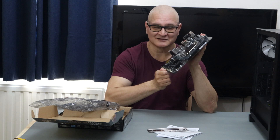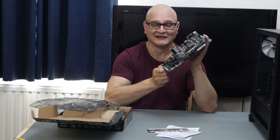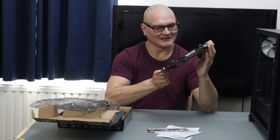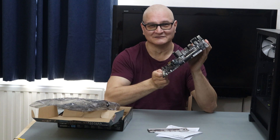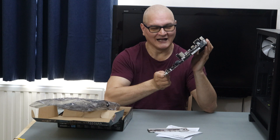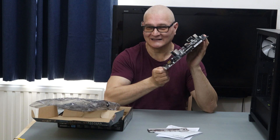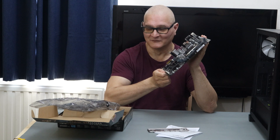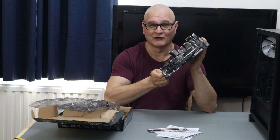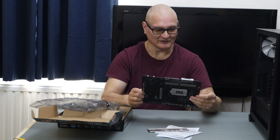With the RX 550 the results come out nice. The integrated GPU, though, is a bit of a disaster — you don't want to go there. I also did a semi-bench stress test running it on a loop for half an hour, and the Pentium Gold never thermally throttled at all — it ran at full speed for the full 30 minutes. Can't complain about that.